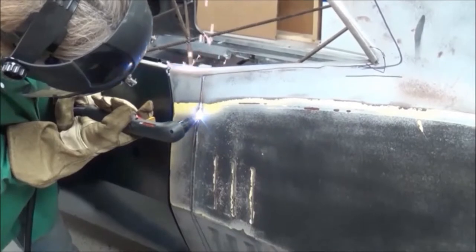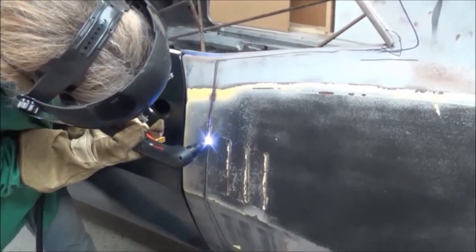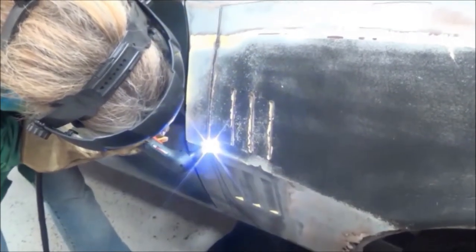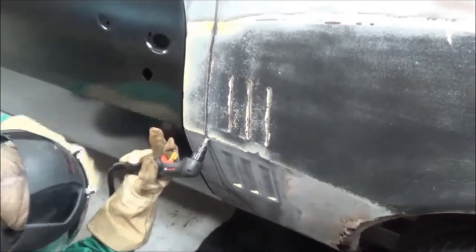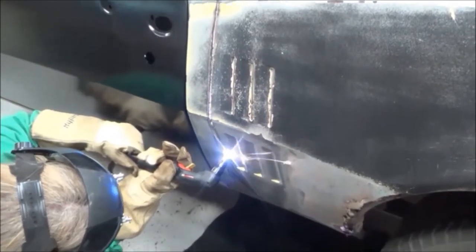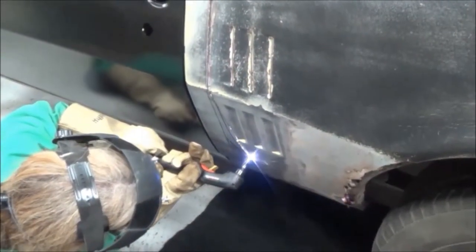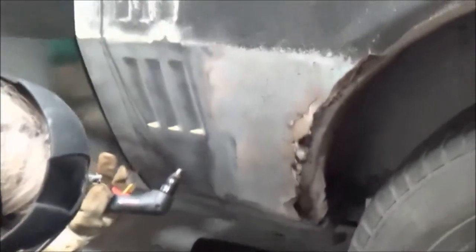Removing exterior panels can be a real hassle. The PowerMax 45 made it quick and easy to cut a nice, straight, clean line through the quarter panel of the Firebird. As with any cutting procedure, know what's behind the metal you're cutting. See my cut line — see how it goes to the right? I had to make sure not to cut through the support for the B pillar. When you want to get the job done quickly, plasma is the way to go. Making the cut from the top of the quarter to the front of the rear wheel well took just under a minute.